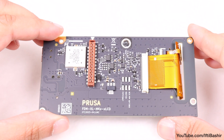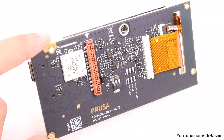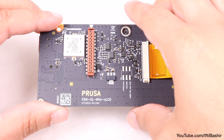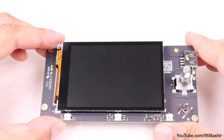Take a look at your display board to determine whether you have version A or B. Version A has the PE connector at the top, whereas version B has it at the bottom right corner. Note there's no functional difference between the LCD boards — the only difference is the position of the PE mounting point and the compatible printed parts.